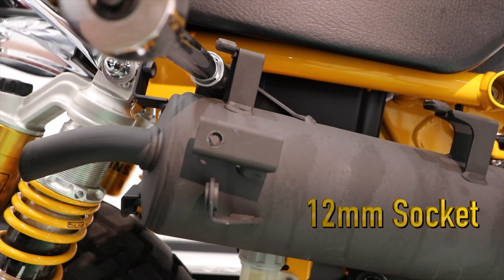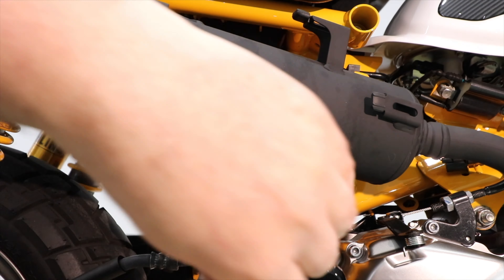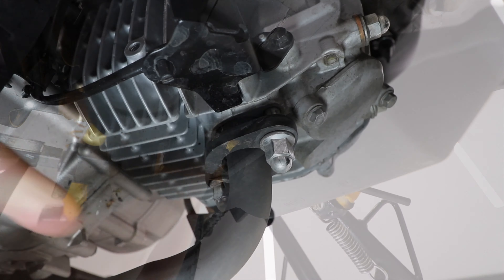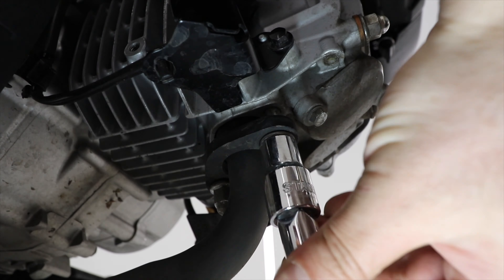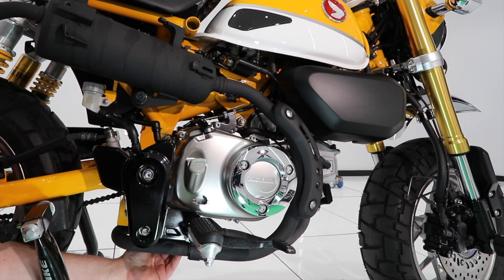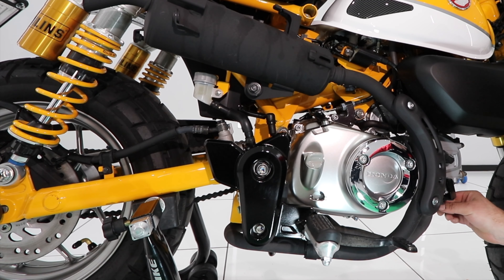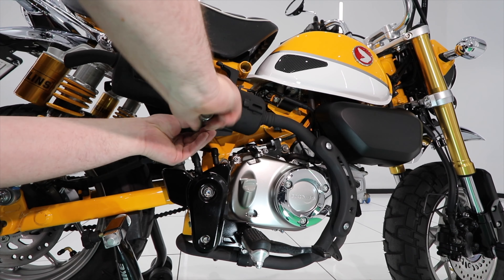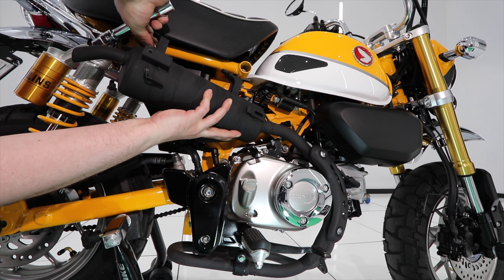You'll then need a 12mm socket and wrench to break and loosen the two bolts holding the muffler — just screw them out halfway and leave them in place. Then underneath the center of the exhaust, do the same for the mounting bolt, screwing it halfway loose. Finally, there are the two exhaust header nuts — break the tension and screw them down halfway. At this point go from the lowest position bolts and nuts to the highest, one by one fully unscrewing and removing them. Once you get to the last couple of bolts, support the exhaust with one hand so it doesn't fall, and it will easily come away from the bike. It's really as quick and easy as that, and it shouldn't take more than five minutes to remove.